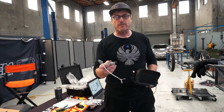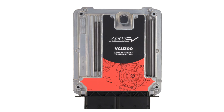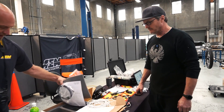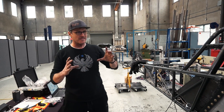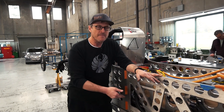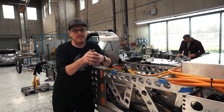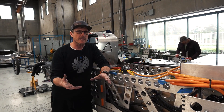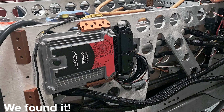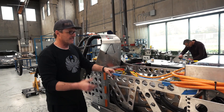We can run all of this CAN data through four wires. We run into a VCU, which we're preparing to mount on the car — we have a new VCU here from AEM. This new VCU, we're going to be mounting it in this area. This all gets covered. This VCU is just like the computer in your car — it takes a lot of inputs and it sends out a lot of outputs, all in one package. AEM has this great controller that allows us to bring four CAN ports into it with just a few wires. It's super fast. It's the solution.